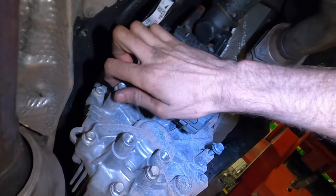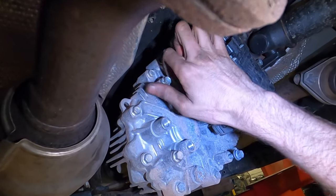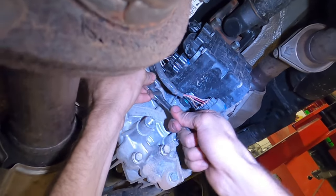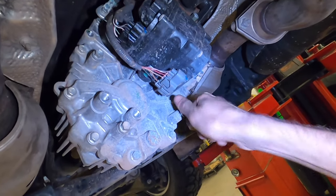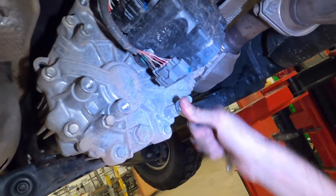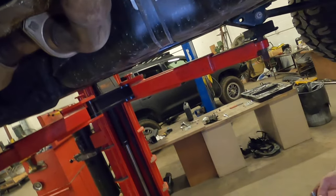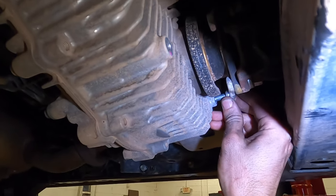This component is really beautiful for what it is. The inside of it is very precision to hold the drivetrain components. It dissipates heat really well. It's generally lightweight, but impact wise, it just can't handle much. That's why we've seen a few cracked cases. That's why we're really against mounting skid plates to this component. It's just not up to the task.